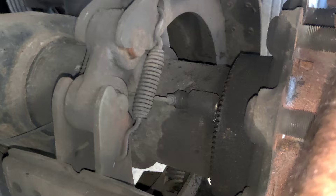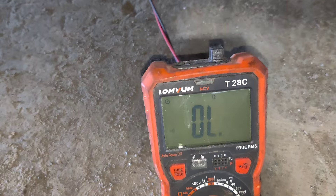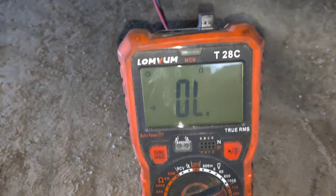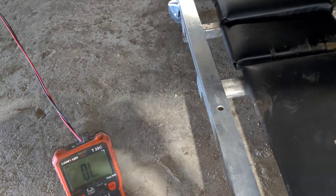You can test it while you still have the tire on. Just spin the tire and connect the multimeter to the sensor connector — the one connected to the ABS module. Spin the tire and you will see if it's good or bad. If you have resistance, it means it's good, but that still doesn't confirm it's fully working. If you also get a continuity sound while spinning, it means it's good and working. If the sensor is bad you will have no resistance at all, or it will be too low.